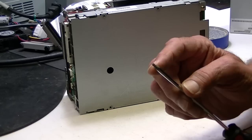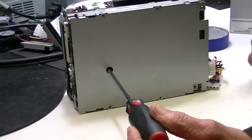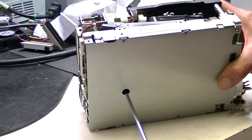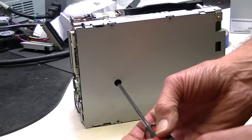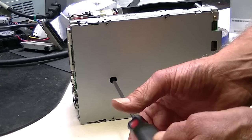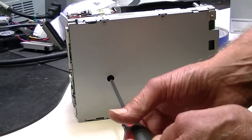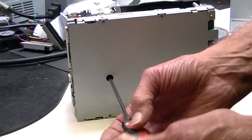We rotate the LTO1 tape. We have a T10 Torx head and we insert that into the hole in the bottom here. That hole will spin the spindle that will take the tape up. What you need to do is spin this clockwise — counter-clockwise is not right. This is going to take a little while, so bear with me. You want to continue spinning this until you feel some pretty stout resistance, then stop when you feel that. It's going to take about 60 seconds. If you've got 2,600 feet of tape on that take-up reel, this is going to take a long time. But assuming you don't have that much tape on there, continue to rotate.